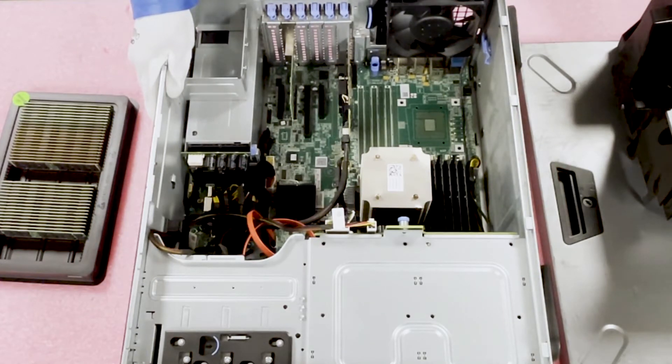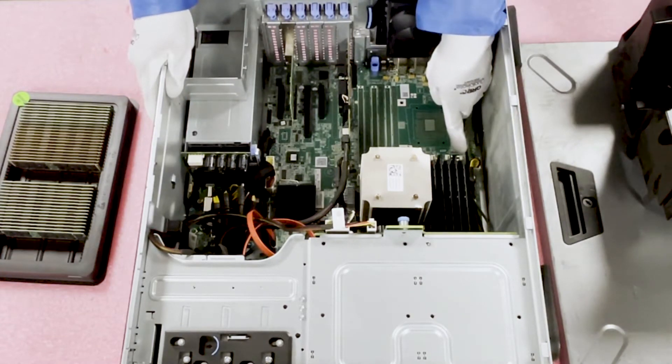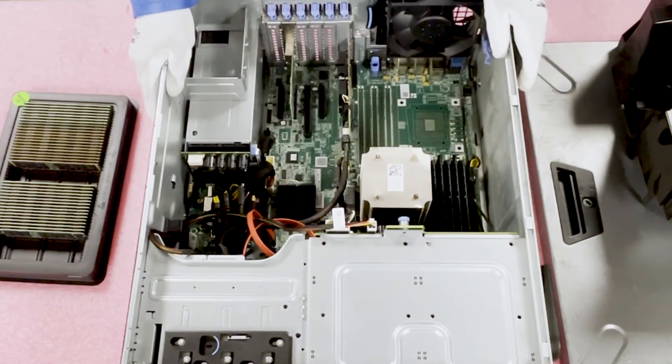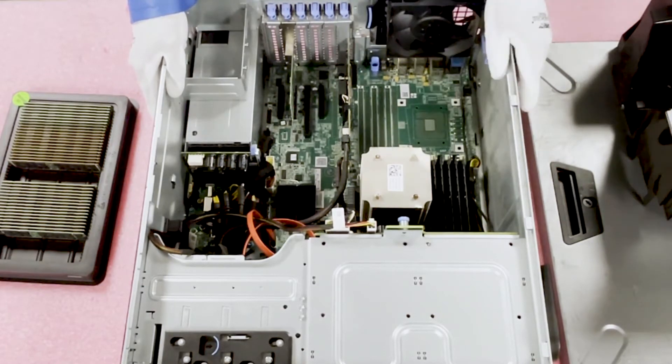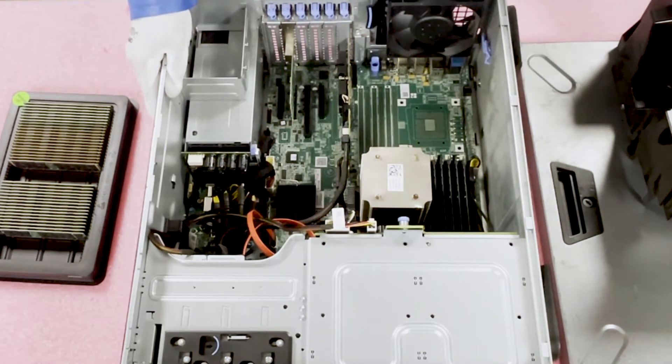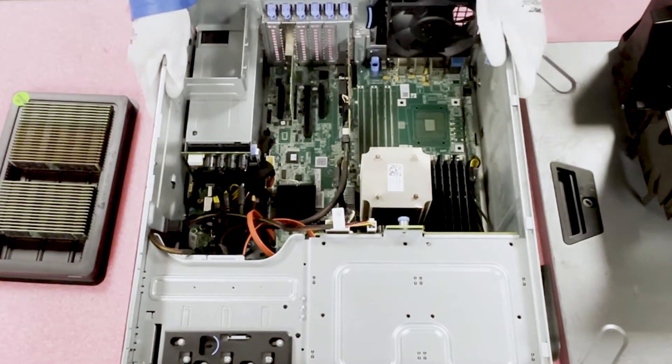The start of each channel has a white tab, so it goes white, black, white, black, white, black. If you're only loading three DIMMs — which is common — and you put in, say, three 32GB modules, you need to put them in the white slots so it's the proper configuration and keeps a nice balance across the load of each channel. Doing white, black, white would be the incorrect way and you won't get the best efficiency. If you're loading all six, just load them all the way up.